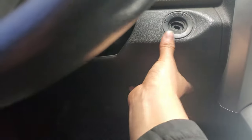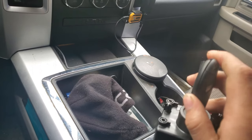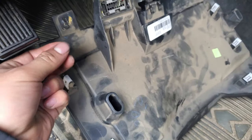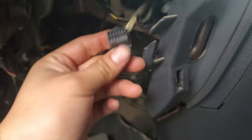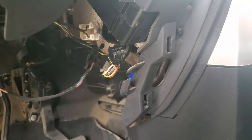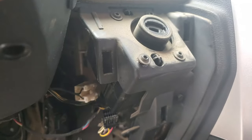This one is going to be without remote start. To remove it, I have to take off this whole trim piece. You just have to remove the two bolts holding it and pull it — it has clips. To remove the box, you have to remove the connector in the back. You'll need a T20 Torx socket to remove four bolts, and the box just slides out.